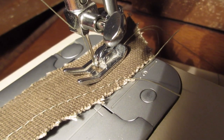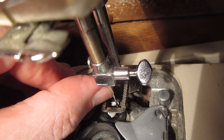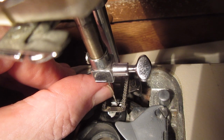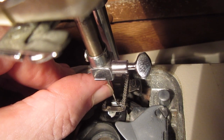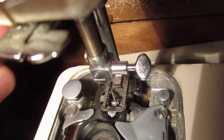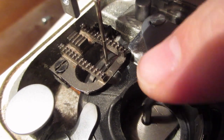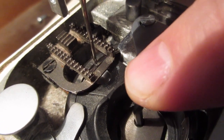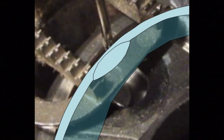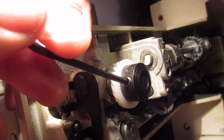It's not good yet. I'm going to show how I determined where to stop moving the mechanism, then I twiddle the hook. Right now the point of the needle is even with the part it was impacting. Now I'm moving the hook spinner thing centrally to that machined-out area. That's pretty much how it looks, and I'm going to tighten it up again.